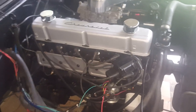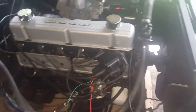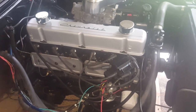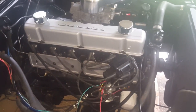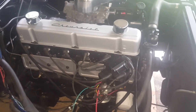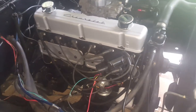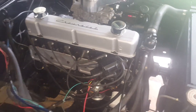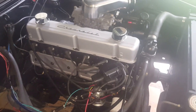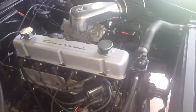A couple of things I should have mentioned earlier. Regarding firing order: if you're just building the engine, the lifter bottoms and cam lobes will have that special break-in lubricant on them. If you do the adjustments in firing order you only turn the engine over once, but if you do it sequentially you turn it over many more times and end up wiping off a lot of that lubricant. So it's better to do it in firing order — get in the habit of it. Also, when putting the spark plugs back in, it's a good idea to check them — look up how to read a spark plug, check for oil fouling or carbon fouling, clean them, and check the gaps as well so you don't have any ignition issues.